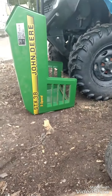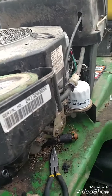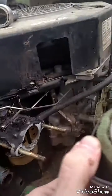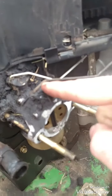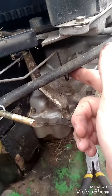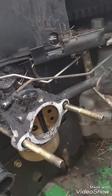I just picked up a John Deere STX 38 from a co-worker and I'm taking the carburetor apart. I wasn't filming yet at first, but there are two screws right here — the air vent sits on top. You unscrew them, take the air vent off, then unhook your throttle cables. There's one here and one there. I'm going to take this one off and clean the carb — you can tell it's pretty gunked up.